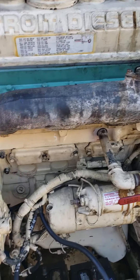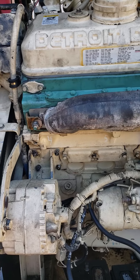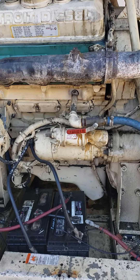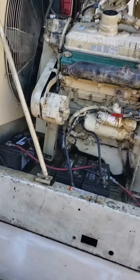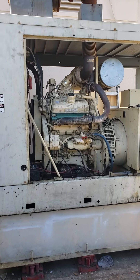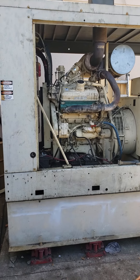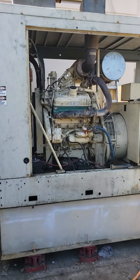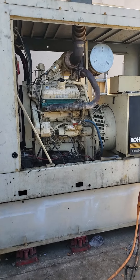It sounds excessive, but once the rings create a groove in the sleeve, there's no removing that groove. They want it to run at full RPM so the rings keep rotating with the piston and it wears evenly. I'm pretty excited about starting this beast up — it's been an interesting job. Essentially we're saving the hotel about a million dollars by not having to upgrade the rest of the system to match a new motor. That's the name of the game: making the old one work again. Thank you for watching.